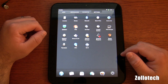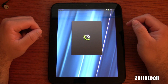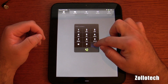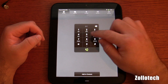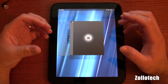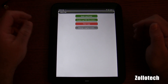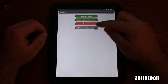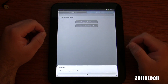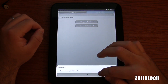We're going to first open our app drawer and go over to our apps and open Phone and Video Calls. Once that's open, you want to hit Dial Pad. And once you're at the dial pad, we're going to dial ##LOGS# — that's ##5647#. Then we're going to hit Dial. That feature is actually there if you have a Palm Pre or Palm Pre 3 — you can actually pair the two so you could make calls through your Touchpad. So all we're going to do here is change the logging levels. Set logging to minimal and hit OK. It's that simple. This says they're already at minimum levels — I've done this earlier. But that's how you do that, very simple. Hit OK and you're done.